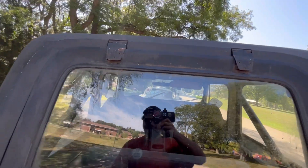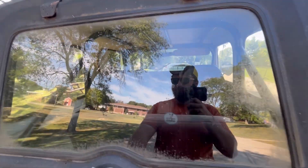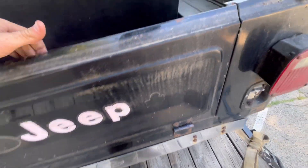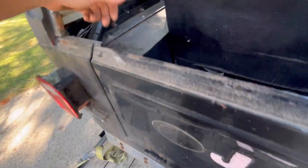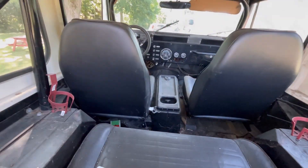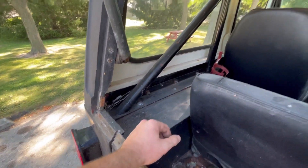The tailgate is in really good shape — one little spot of bubbles and a crack in the Bondo. Coming back here there's some rust on the top, which I've never seen before, and the top is actually rotted out — but it still works. I don't think I've ever had a CJ7 with a functioning tailgate either. The hinges are seized up; I don't want to yank on it and bend the body. The floor back here's not bad. Underneath the roll cage it's been patched — it's an aftermarket roll cage, which is kind of nice. I can actually call it a cage because it goes all the way to the front, though it doesn't tie into the frame — just ties into the rusty body.